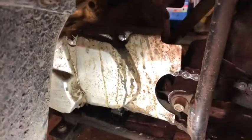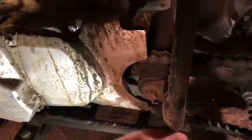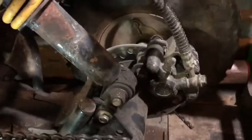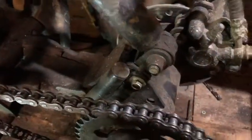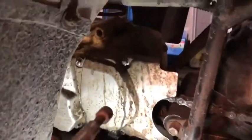Off the back of any of these little Honda clones, they have this little cover that covers your main drive gear that goes back to your rear sprocket. The tensioner for this bike doesn't have an actual chain tensioner — it goes off the tension of the rear sprocket, adjusted by loosening this bolt. There's one here and one on the other side, and then you can adjust it by these little screws underneath.